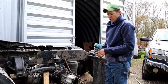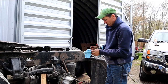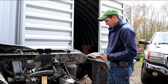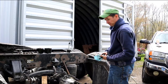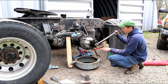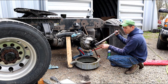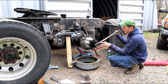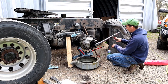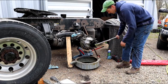Now we're going to torque it down. The procedure for this ProTorque / Stemco ProTorque setup: torque it to 200 foot-pounds, spin it at least one turn, torque again to 200, spin again, torque again to 200 — so three times, spinning at least once in between. I've got a digital torque wrench set at 200 foot-pounds; it beeps and turns red when it hits 200.